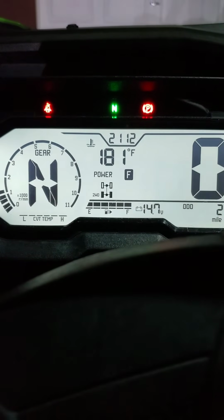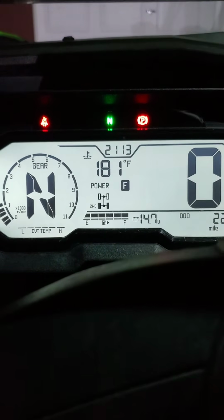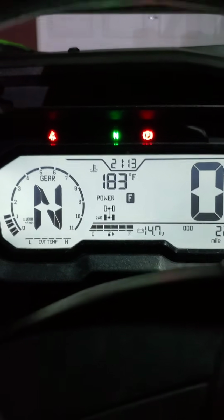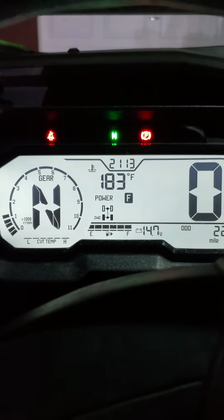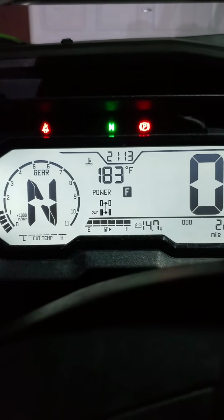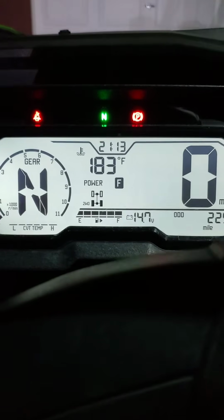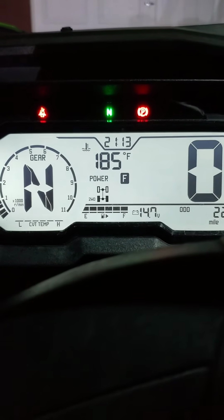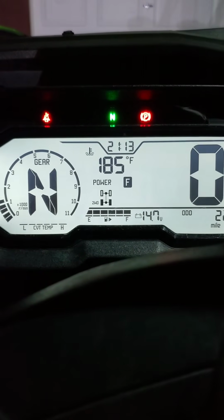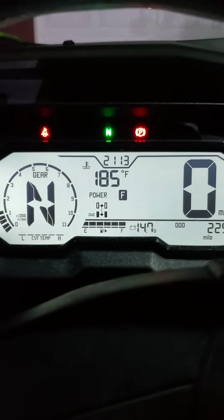There's a couple guys that said if you put the single exit aftermarket exhaust on there, which makes it really loud, it also kills the power. I haven't noticed any power loss. I haven't noticed anything. But full disclosure, the one thing you will notice, which has only happened like 1 or 2 times in probably 20 hours of riding, is if you're in a super tight section and you're 100% throttle, 0% throttle, 100% throttle, you'll hear a slight decel pop. I don't think it's anything that's going to last, because honestly the last time we went riding I didn't hear it, but I did the first couple times. But just something to keep in mind.